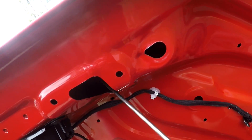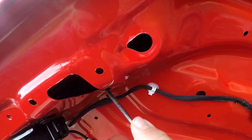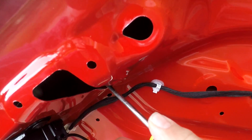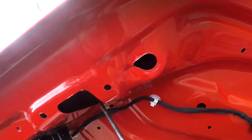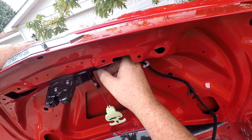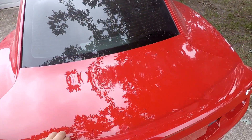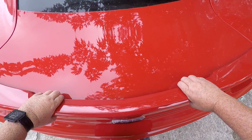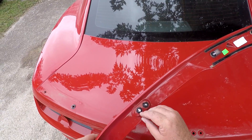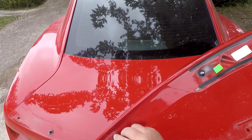You need to grab a hold of the spoiler — there's a little white plastic retainer clip that keeps it from falling off. I'll show you what it looks like when I get it off. We have the plastic clip removed, pushed in enough where we can get this thing off now. Close down and pull it off. This plastic clip right here is what I was talking about — it pushes in and flares out so it won't fall off while the factory workers are putting the nuts on the bottom of it.